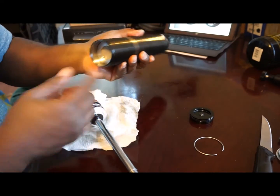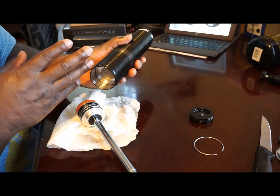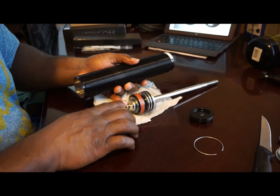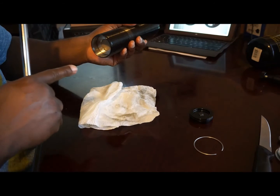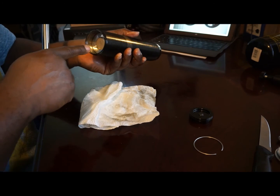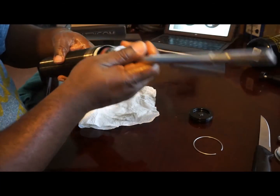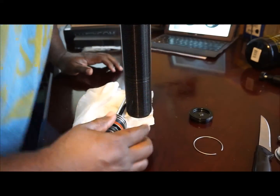You can technically push it 75% in and have a 25% gap between the sliding piston and the shock shaft nut — it's up to you. For me, I'll put it at 50-50. Just keep in mind when you push the needle in, you don't have to jam it in — just enough to break into the air chamber here is fine.